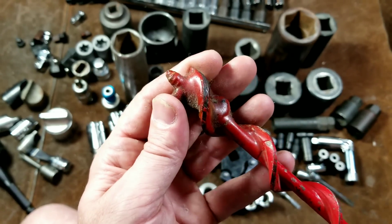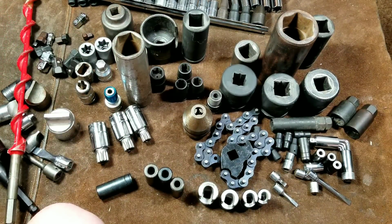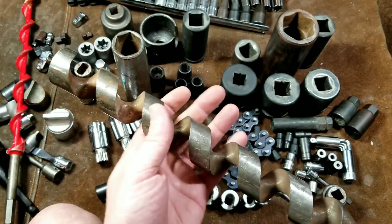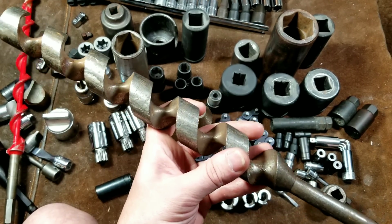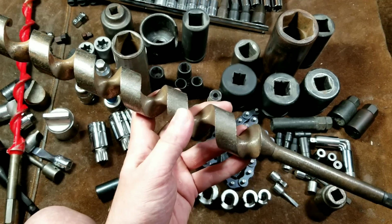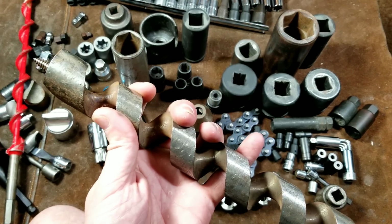This is a high performance ship auger that has carbide teeth. It's rated for running at very high speeds. The most common time I've actually used that is with these. Oftentimes I'll be using these ship augers. I won't pull them out as often as I need to clear out the chips. You're just trying to get a hole done. Obviously with these large ship augers, you're drilling deep holes, and so they take a lot of time, and so you're just trying to get through it, and then inevitably you didn't pull it out enough, and enough wood chips get in there to where it really jams up.